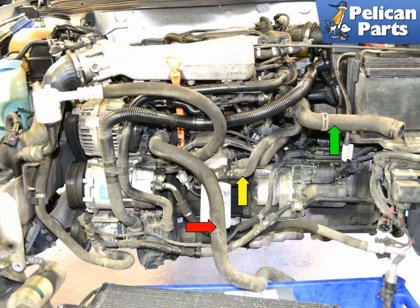With the front of the vehicle removed, you can see the major hoses you will want to check or replace. Note, you do not need to remove the front of the car to perform this work — this is strictly for demonstration purposes. The coolant hose to the radiator and thermostat pump is indicated by the red arrow, the hose to the radiator and flange to engine by the green arrow, and the hoses to the oil cooler adapter piece by the yellow arrow.